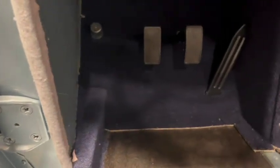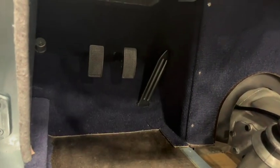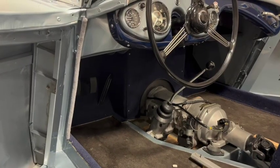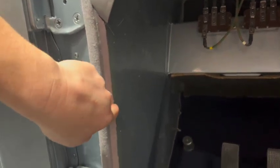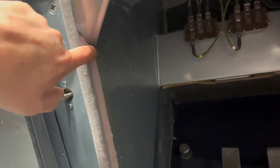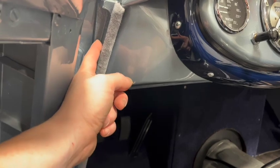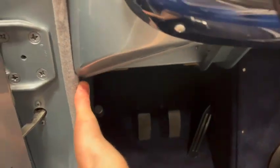I leave the sill cutouts in my carpet a little bit oversized so you can get a perfect fit — they're just cut with scissors. Every car is slightly different, especially in restorations where sills are getting changed, so leaving them oversized lets you cut them to fit perfectly. I've just installed this piece of fur flex here, preparing to put in the kick panel. You glue its tail along the flange, then snip it even with the edge, and the tail flips around and gets stuffed underneath the windshield posts. Once that's stuffed in there I can tighten up the windshield post bolts, which holds it in place, and now the kick panel can come in and screw in place using my original screw holes.